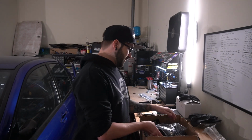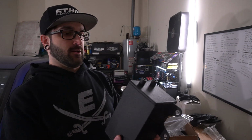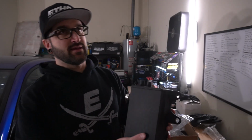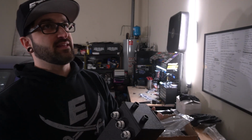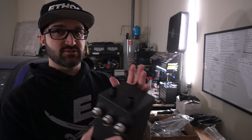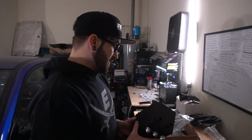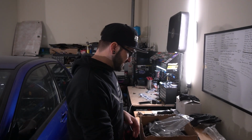In today's video, we're going to be installing a brand new STM oil catch can. I had them custom make this one. Well, they custom make all of them, but normally I think it has one 6-AN and one 10-AN fitting on there, and we got three 10-ANs on ours. It mounts to the transmission, powder coated wrinkle black, should look really cool on there. We got lots of lines and stuff like that to run as well. So let's just get right to it.